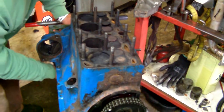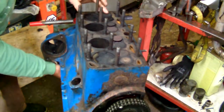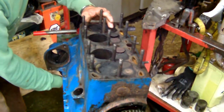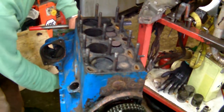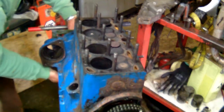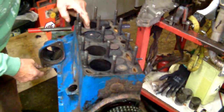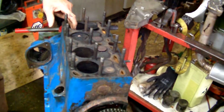Right, let's go for this. We've got TDC — I know I'm on TDC there because these are rocking. So that's on TDC. Piston's going down, it's fired actually, that's what it's done. This one's sucking fuel, this one's fired and being blown down, and as that piston goes down, it's actually sucking in fuel mixture now.